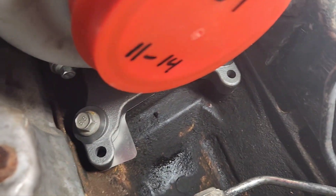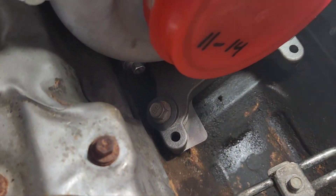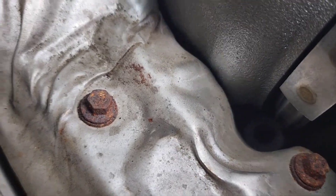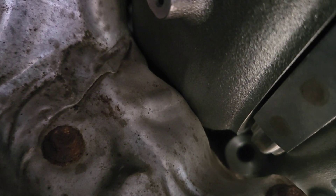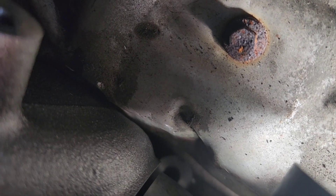Real quick — two front ones are in. This is actually lined up with the dowels and guide pins. Now I'm seeing here — see how close that is? The bolt won't even go through that area. It is so tight, I may have to hammer that heat shield down a little bit to get it to work, and it's the same situation on the other side. Bolts won't go through those heat shields so I think I will have to hammer it down slightly.